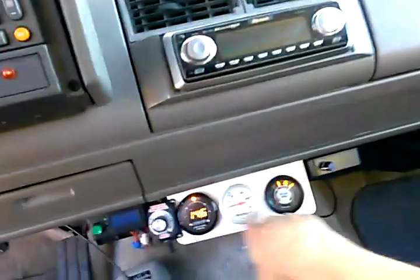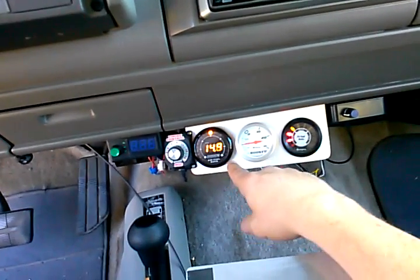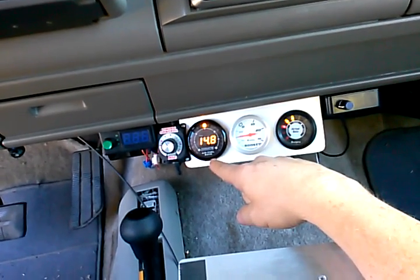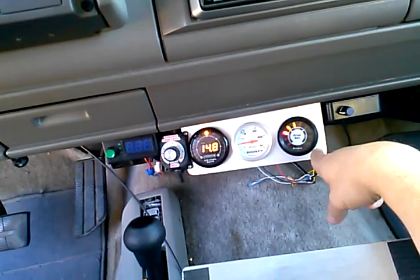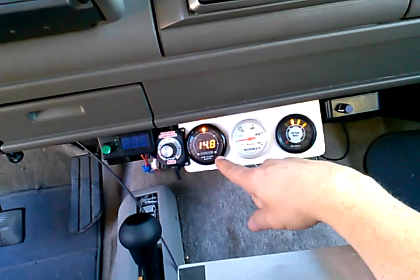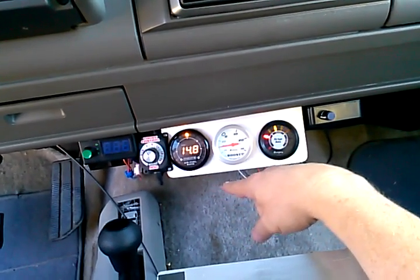You can see that the computer is swinging its air fuel ratio from 14.7 — 14.5 to 15.1. As the air fuel ratio gets richer, you can see it gets richer, it shows over there 14.7, 14.6, whatever. And then when it goes lean, it goes up to 15.1, 15.2.